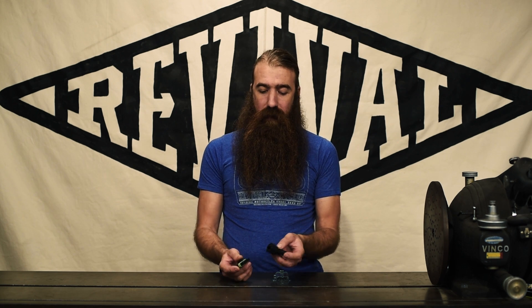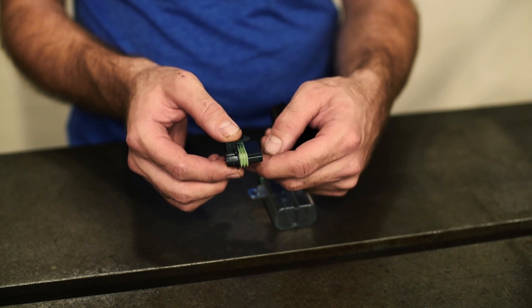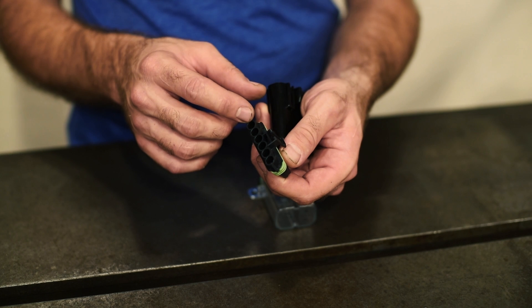There's a three-position, which has six terminals in it, and that means you can fit three fuses in this. Basically what this one can do is provide three positions of waterproof fuse protection, so you can have three different circuits. All of it's waterproof — you've got a silicone seal here, cable seals back here, and you can put fuses in this.